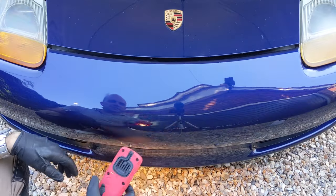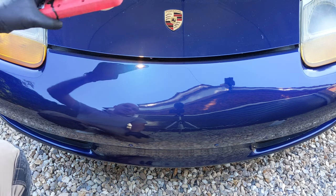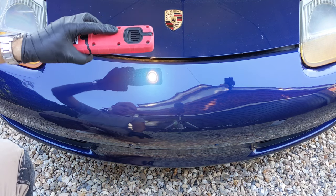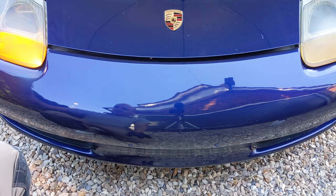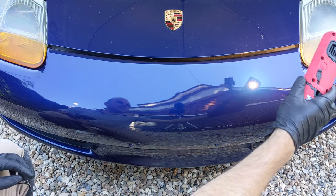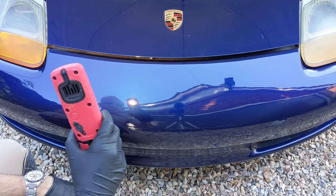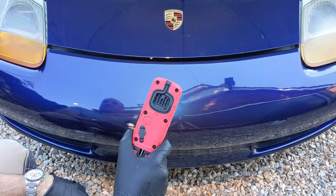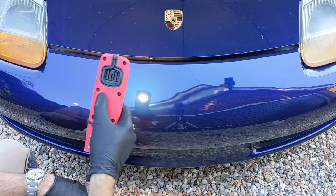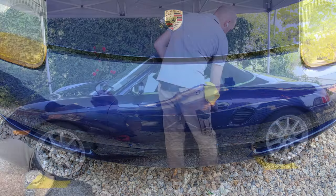Well, it worked. That is the main thing. I didn't need to switch to the 205. Using the Meguiar's 105, using the ONR as an additional bit of lubrication when wiping off has yielded the results. So I'm really pleased with that. All the polishing is done. So I'm going to stick you back from afar. I need to do an IPA wipe down and then apply some Nova Lustre. There's onto the interior.